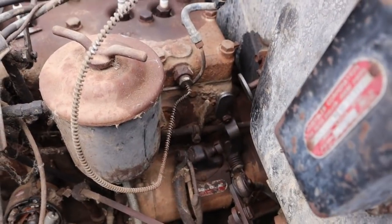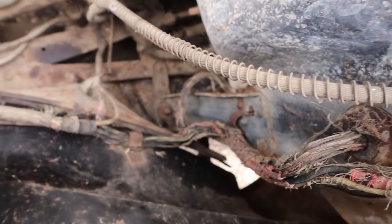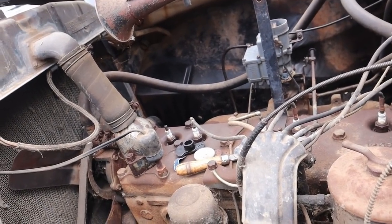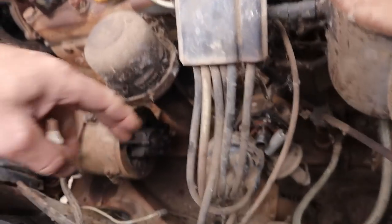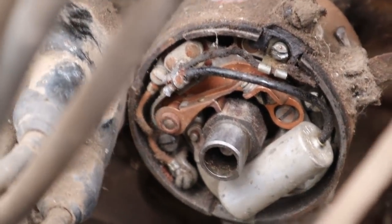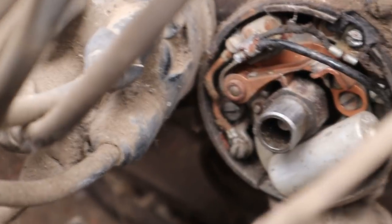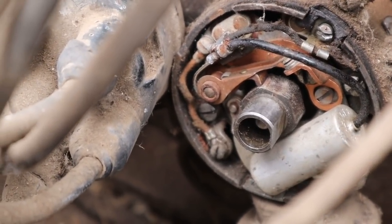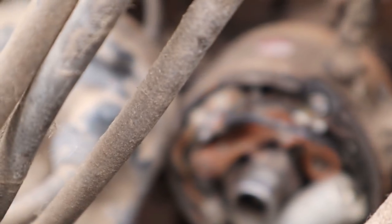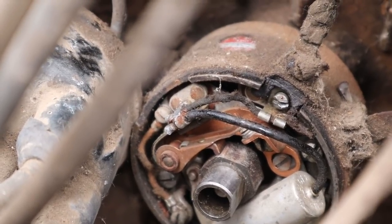I'm probably going to unhook the main power feed to the rest of the car because the wiring, as we may have pointed out, is suspect. Everything else looking pretty fair. I cleaned the points. Somebody has put a cap and rotor on it at some point, trying to get it running, I suspect. I see a lot of slack in the timing chain, so that might also become a real issue if it won't start. I suspect it'll still go, but it's not going to be ideal.